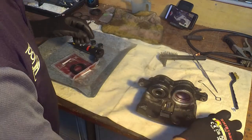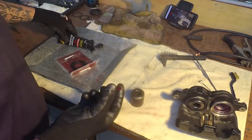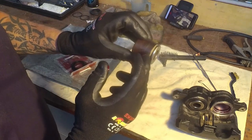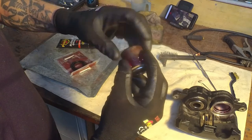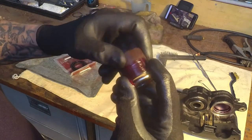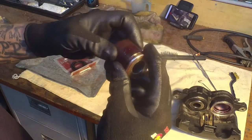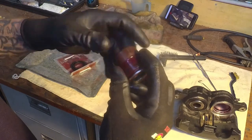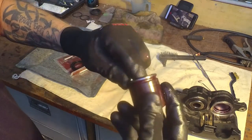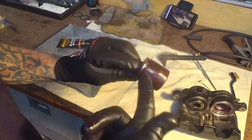You get your piston which has been cleaned up, get a good dollop of grease on your finger and thumb especially around the end where the seal will be - not so much necessary further up, but I do the entire thing. Just rotate it around in your hand so you can get grease right into all the grooves where the seals and dust boot sit. Stick your finger in the hole to do the other end as well, getting a good layer all over the piston to help protect it from corrosion.